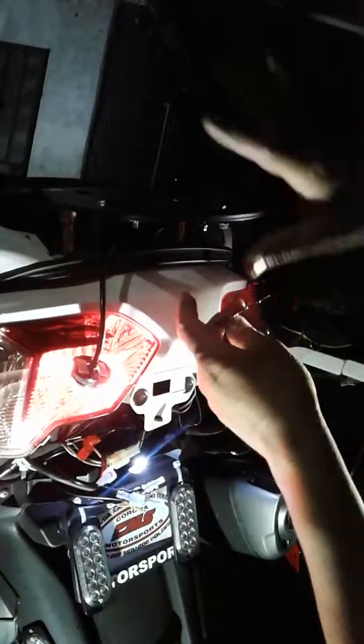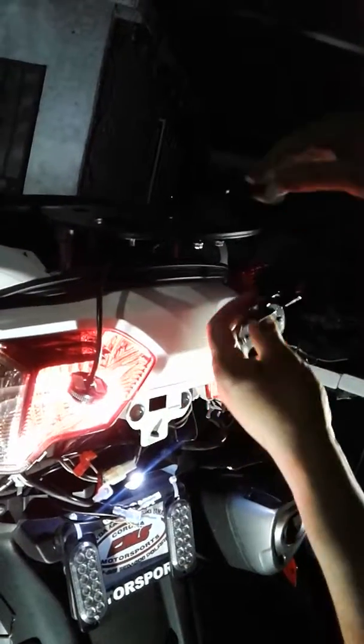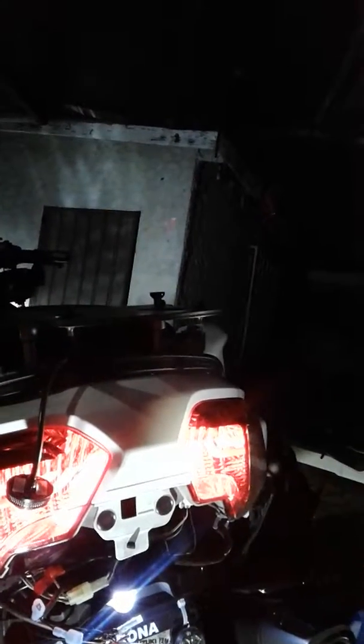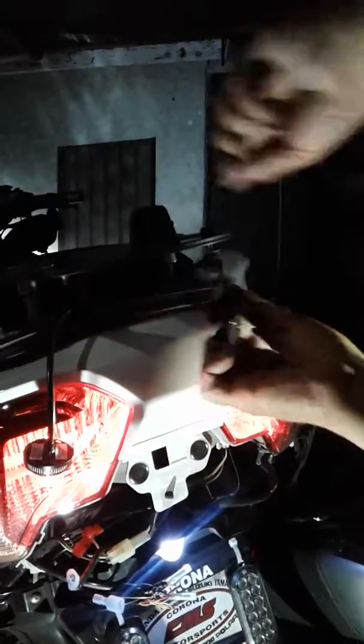We're back. I took the top case off — it's pretty easy, no explanation needed — and I've loosened the bolts. Now we're going to mount this guy under here. It's not as easy as it seems; it doesn't just bolt right up. I actually had to drill these holes out so they matched, using a Christmas tree drill bit. Spend money on a good bit.